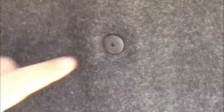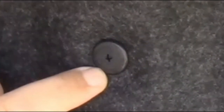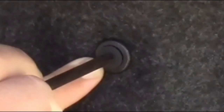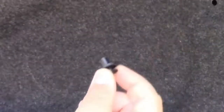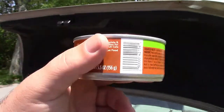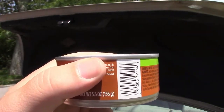With these type clips, if you look very closely, the Phillips piece is like an insert, and around that is the rest of the clip. What you're going to do is put your fingernail or finger on that, put the Phillips screwdriver in there and turn it counterclockwise. You may notice how the center has popped out. Then simply grab the whole thing and pull it right out. It would also be wise to get some sort of container — it can be a plastic cup or an old cat food can — and put all of those in there so you don't lose them, because you have to reinstall them at the end.